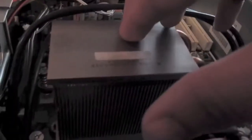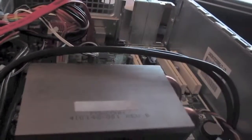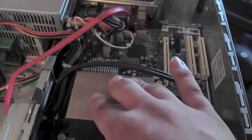That's why I can't really use this machine for anything right now — I'll overheat it and kill the processor. I'll probably have to put a Celeron 420 in there. I hope that thing isn't busted, because it gives me 5 beeps, which is a bad processor in these machines. So the CPU heat shroud is missing, making it really not usable right now until I get that shroud.